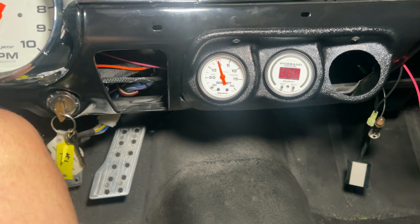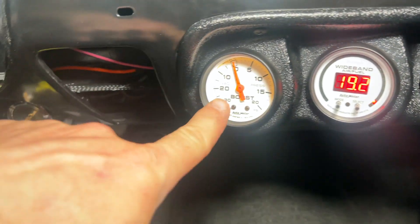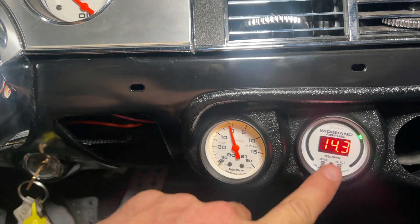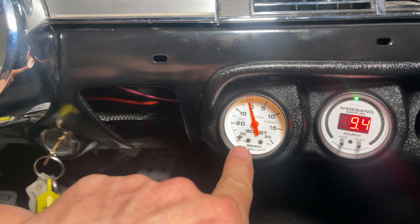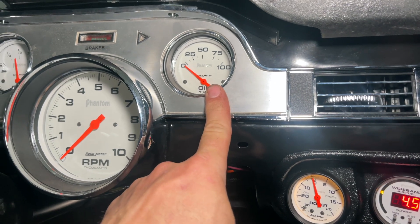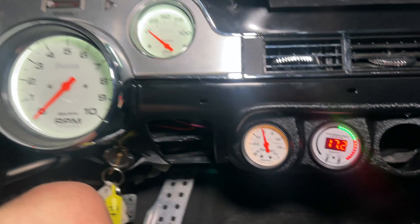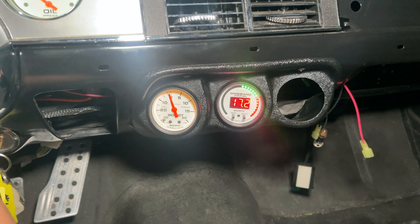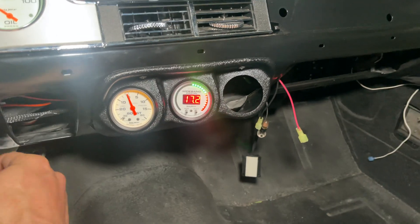Before I start the vehicle, I'll show you guys a quick mistake I made with the light. I wired it to the ignition wire, but it shouldn't have been wired like that because this is a mechanical gauge. The light should have been wired off one of the light hot wires so that when you turn on the vehicle lights, that turns on. This gauge doesn't have a backlight so anyway — quick little fix. I'll show it in the next video when I put the voltmeter in, and let's see if it works.